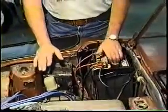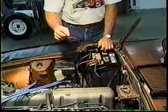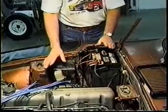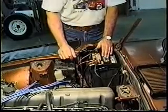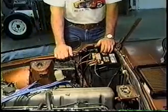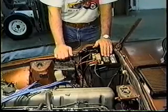Bosch originally designed this fuel injection system to compensate for the fact that after you start your car, the voltage drops on the battery. It increases the pulse width on the injector — the injector opens and closes on a millisecond rating. A low voltage situation, whether induced by resistance anywhere in the system, will automatically tell the fuel injection brain that either the car is cold or we have a low voltage situation, and it increases pulse width to compensate. The amperage then starts to burn up the injector and causes it to keep its pulse width wide, so it runs rich. If you think your mileage is down and you need to buy injectors, go over here, clean this up, get your alternator cleaned up — you'd be astounded how many problems are solved by just doing that. So what you're saying is if my car is running rich and can't pass smog, I should clean my battery terminals? Absolutely.